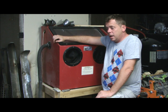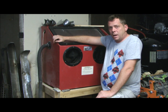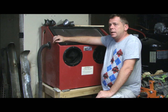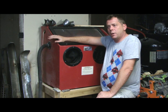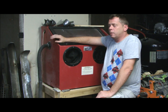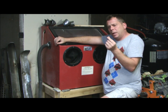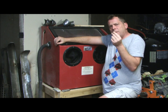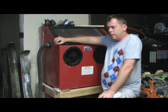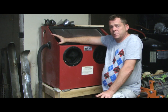What I found from switching over is it's a very painless process. The major things to keep in mind when soda blasting versus traditional sandblasting is it's a little bit more of a patience game. The better you can clean something off before you put it in the box to blast it, the better you'll be. Also, when you media blast with baking soda, it creates a very fine film across the entirety of the object, and you have to deal with that. Basically, you can't paint, prep, or do much else with it after it's been done until it's been cleaned.